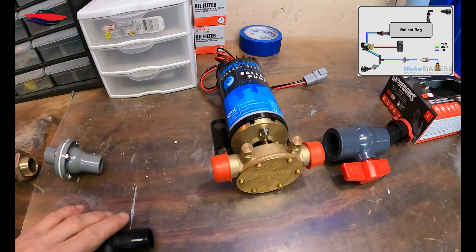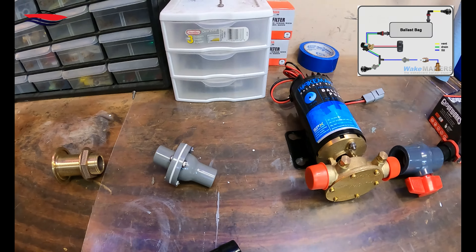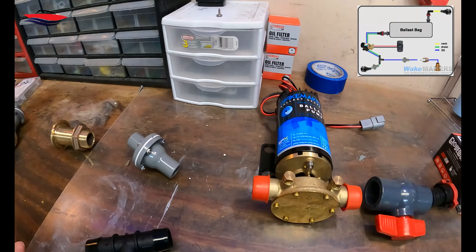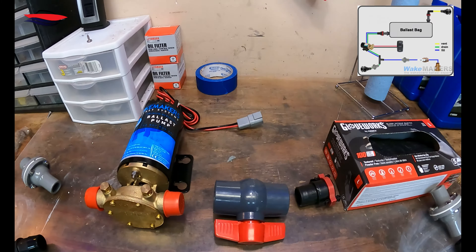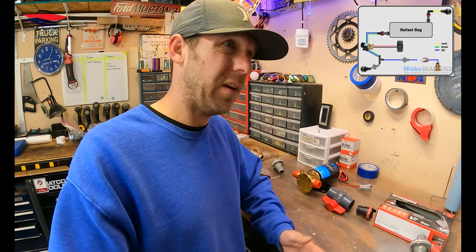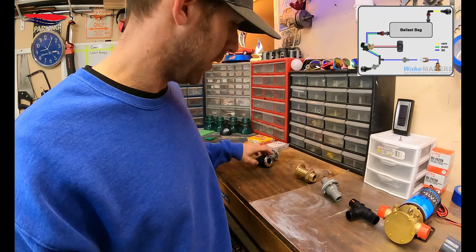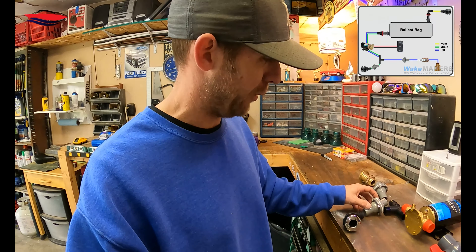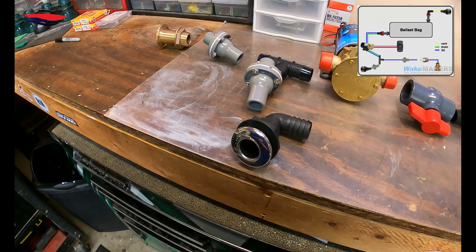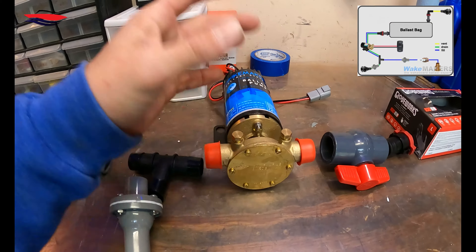Now I want to drain all the water out — flip the pump on in reverse, water starts getting drawn out. Since there's a check valve on the vent side, air cannot suck itself back in, so it's going to start collapsing the bag. The water comes out and because there's a check valve the water cannot go back through the intake, so it's forced out the topside drain. Why not just skip the T and have it come straight out through the fresh water intake? The problem is I won't know when the bag is done emptying. Timers get messed up, water gets left in — I'm not a big fan. Once water stops coming out the side drain, I know the bag has collapsed and I can shut it off without running the pump dry for too long.